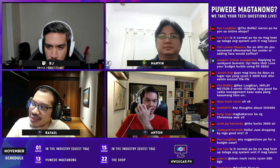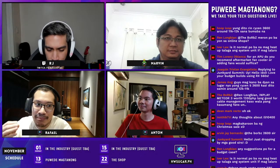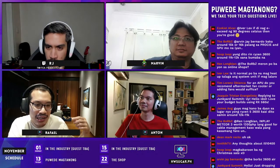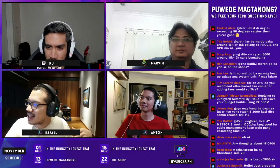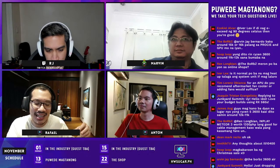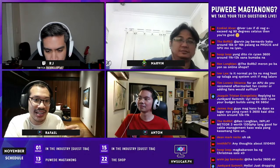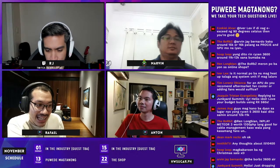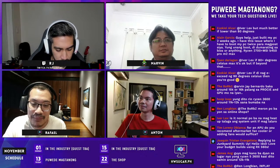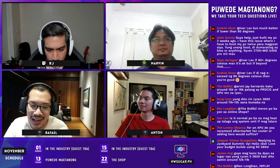And the second problem naman is if you're going completely just negative pressure, now you end up actually pulling air through places you don't want to pull air from. Because when you're trying to expel all the air inside your PC, it will amount to removing all the air inside your PC, but new air gets pulled in, actually, in the end. And the parts where it pulls the air in are the small gaps, which aren't even part of the fans anymore. So you end up dirtying places which aren't really meant to be dirtied.